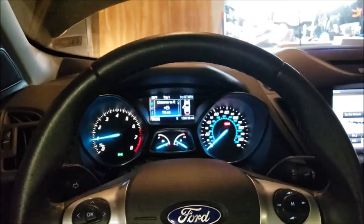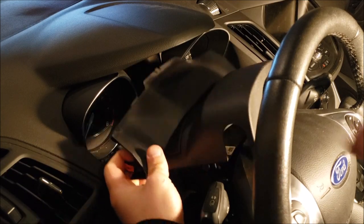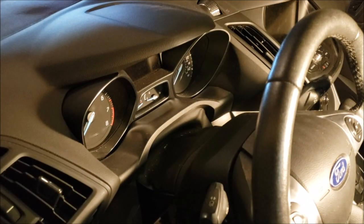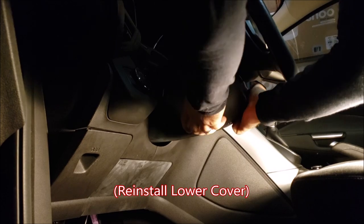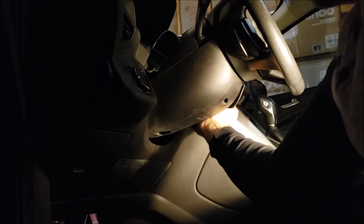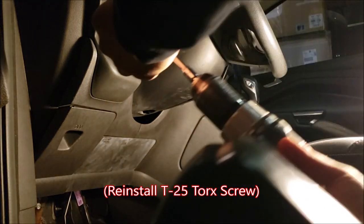I'm going to put the upper and lower shrouds back on the steering wheel. Make this part sit, and take this piece and push it back into the dash right underneath the cluster. Let that sit on top. Now with the lower shroud, tuck it back in there, get that nice seam — hook in, come up, snap to get that seam. Reinstall the 7mm screw on the bottom, then use the T25 Torx driver to reinstall that screw.